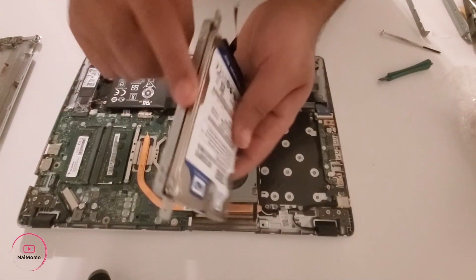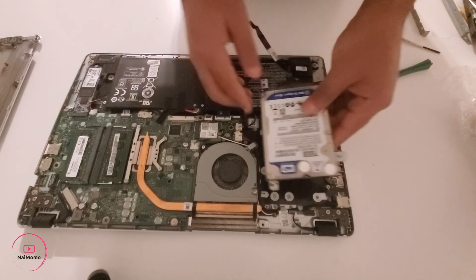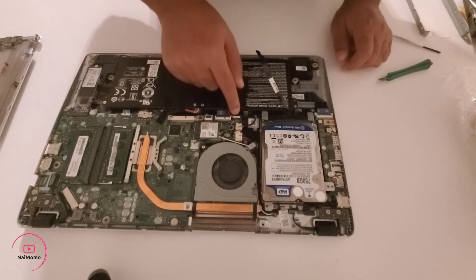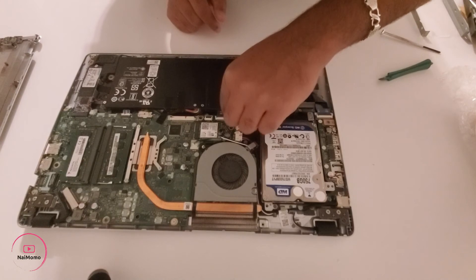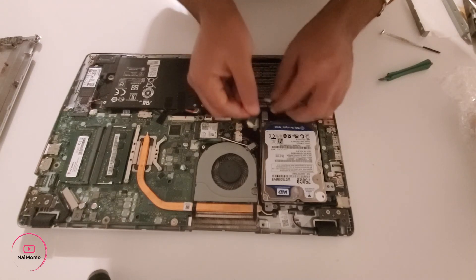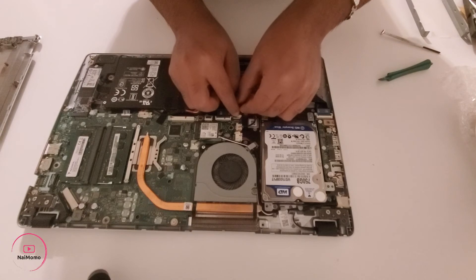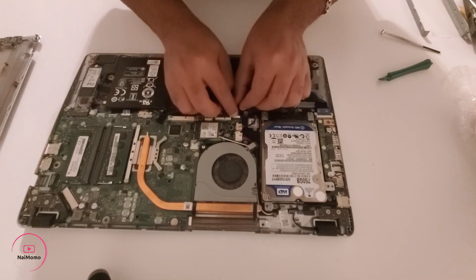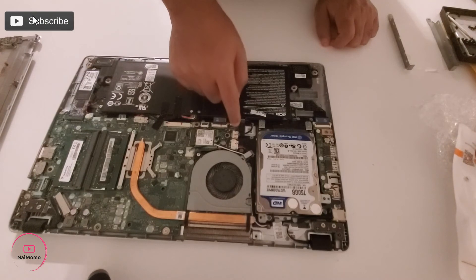Now that I have connected the mounting bracket to my hard drive and the cable is connected on this side, I'll just put it here. This other side has to connect to the motherboard. Looking at mine, it says HDD1 — so that should be where I connect this cable. There's a white part that, if you pull it up gently, it comes up and then you can put the cable in very easily. The cable is now connected.